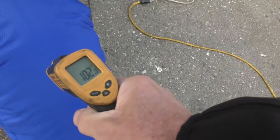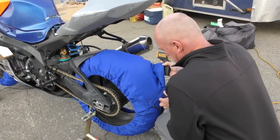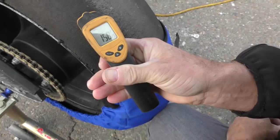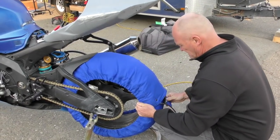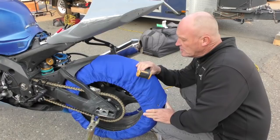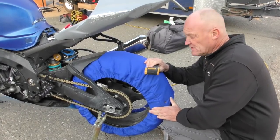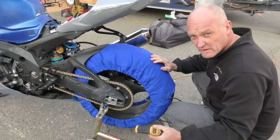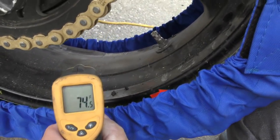The back is showing about the same. All nice and new and sticky Velcro. After our allotted period of time we're at 160 degrees, up from our original temperature of 40 — that's not bad. We'll leave this now until we go out, then recheck in another 15 minutes and see what increase we get. The other part about getting everything hot is the tire gets hot, but does the rim? It's really important that the rim gets hot, because until the rim's hot it steals heat from the tire.